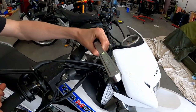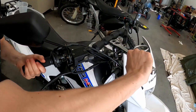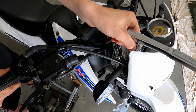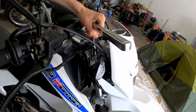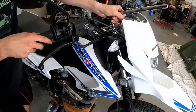I've got one fork drained and now I'm going to show you how to do the other one, in case you've got a Tao Tao of your own. There's a cap up here with a 17-millimeter head on it — you've got to break that loose. There's going to be some spring preload on this, so you want to have a firm grip on it so when you get the cap all the way out it doesn't go flying. You want to have the bike up in the air — I've got it on a jack so there's no weight on the forks; otherwise the spring load will be a lot higher.